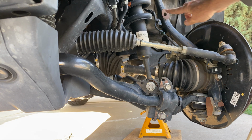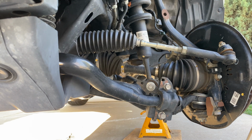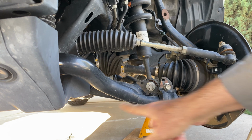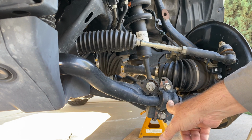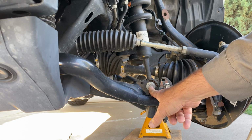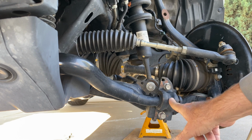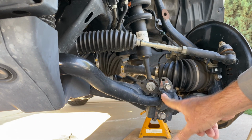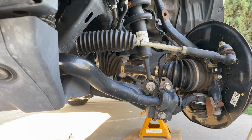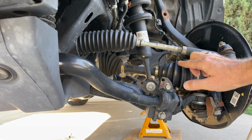But the standard Toyota 4Runner mounting here would have a 1-to-1 motion ratio, so its smaller bar would be 100% efficient. This one is bolted midway out on the lower arm at about, looks like 70%. You know, the coil-over shock absorber is more like 60, and this looks like about 70%, maybe 75. So this bigger bar isn't 100% efficient like the standard 4Runner bar is. Still, the difference here is bigger than this liability.